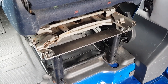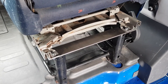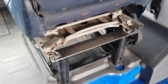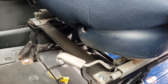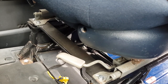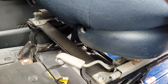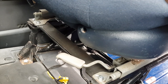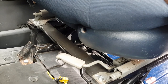In the end, we opted for 30mm bolts to attach the captain's chairs to the brackets, because the 20mm ones weren't quite long enough when you take into consideration the locking nuts. When bolting the captain's chairs to the brackets, we've also had to add some washers because the holes on the captain's chairs are quite big, so the washers just give you that added reassurance that you've got a nice secure fit.